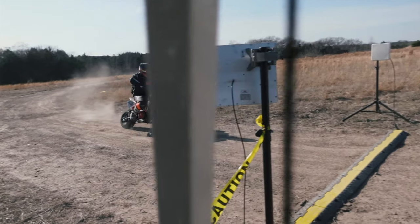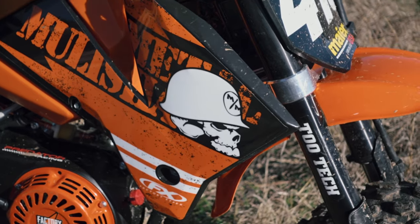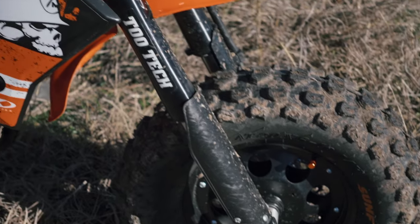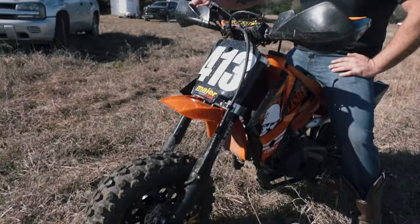The whole backbone, swing arm back in, I built myself and made some billet triple clamps, put some pit bike forks on it, 10-inch front wheel, some old KTM plastics I had laying around the shop when I used to race real motorcycles.